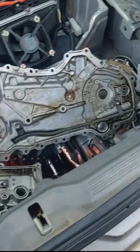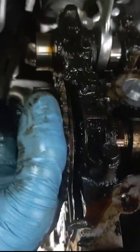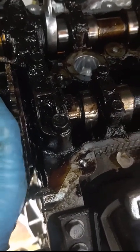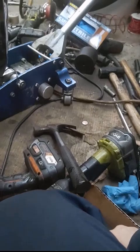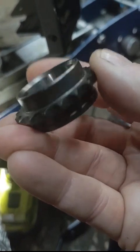I held this with the wrench and took this off - no problem. But this other one makes a noise and has movement; the first one didn't have any movement. I don't know if that's because it's full of sludge - we're not getting codes for this but I didn't expect it. I also took this out of the box - I remember having a problem with the camshaft gear on a Volvo where it had no keyway. I look at this new gear - brand new, and there's no keyway.